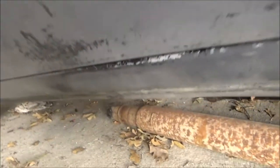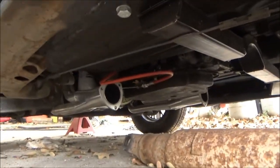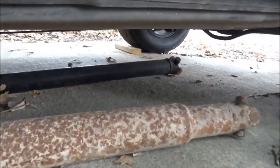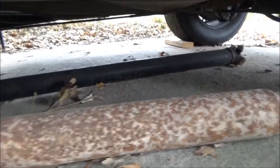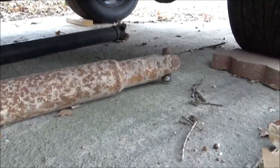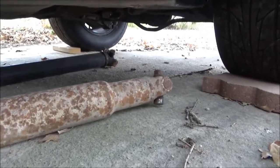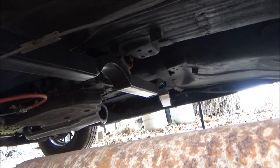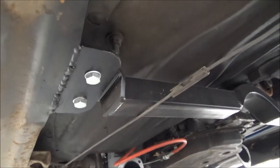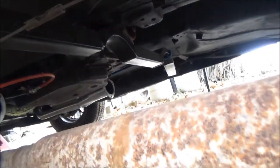The transmission is not hooked up now — it is bolted to the engine, but the torque converter is not hooked up. I do have the exhaust already built, just don't have it on. I've got drive shafts laying here; I was trying to find one that's close enough to modify, which is this brown one here. I'm just waiting on my Turbo 400 yoke, which should be here in a few days, and then we're going to shorten this drive shaft. I got some Spicer heavy-duty U-joints for it so it should hold just fine. The transmission crossmember I got from Jegs is made for a G-body with a Turbo 400, but for some reason was too short, so I had to make a little extension plate — kind of weird, but whatever, I got it to work.